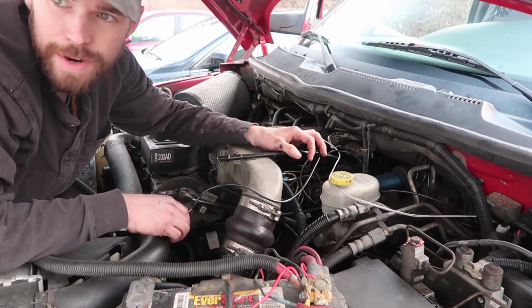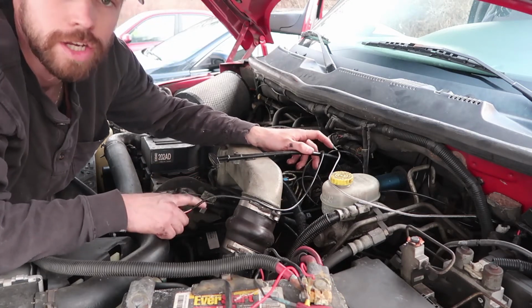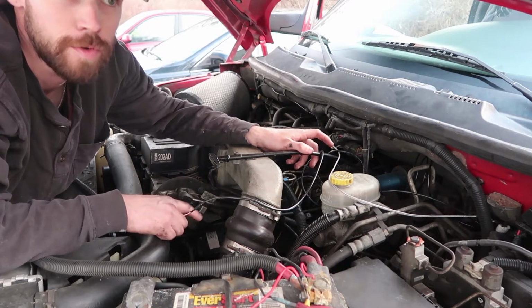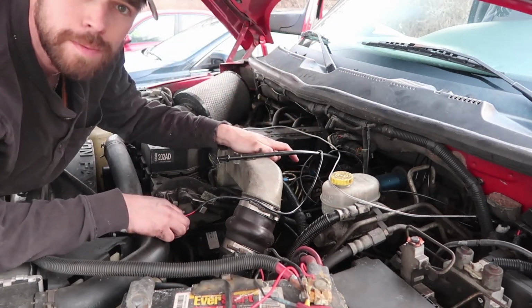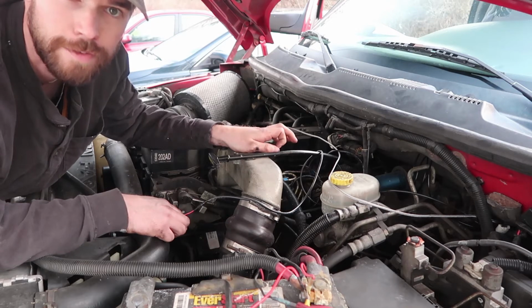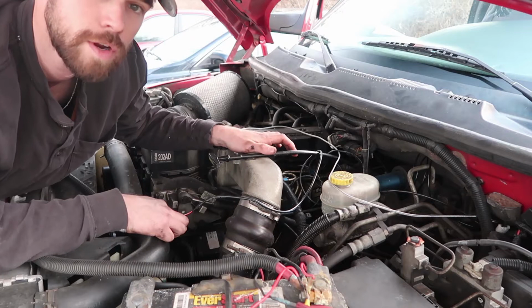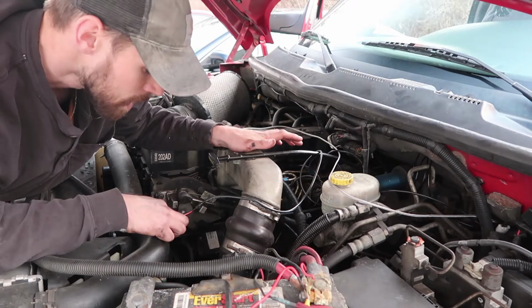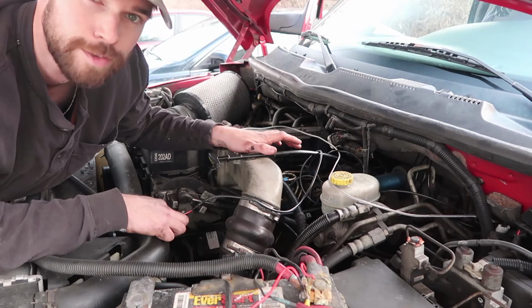to... Hey, there goes someone in the old second gen Cummins. But that's where I plan, like I was saying, to hook up my fuel pressure gauge, in the VP44, not at the bottom of the fuel filter housing. Unless for some reason I run into an issue when I go to connect the fittings, but I shouldn't, because I already have the banjo bolt in the VP44, so I should be good to go as far as taking out that low fuel pressure alarm and then plugging in my sensor for the gauge.